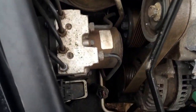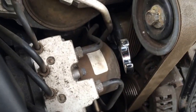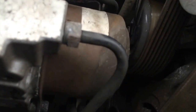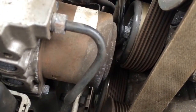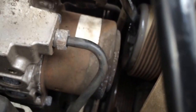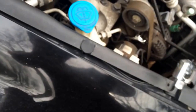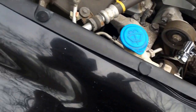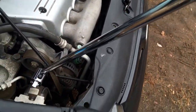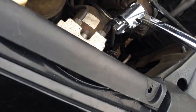Since I didn't feel like going out and buying a specific pulley wrench, you can easily do this method right here, which I came up with. You want to take your 14mm wrench and put it on your tensioner pulley. Then take your breaker bar — this is a 1/2-inch drive — and simply plug it right at the top. All you literally have to do is pull back towards yourself so that you release all the tension off the belt, and you can see the belt coming off.